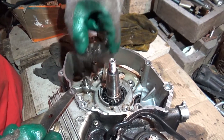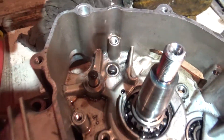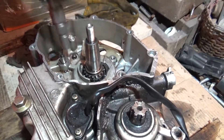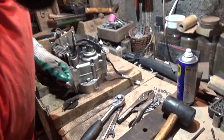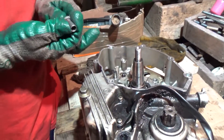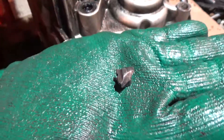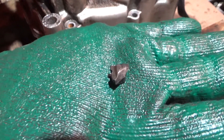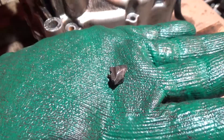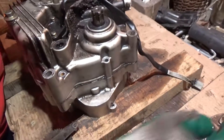I'm going to pull this gear out — this goes like this — and I got one last. I'm not sure if it's a 10mm or an 8mm that I gotta pull. And the gear parts already started popping off of the engine, and I think this is why it was rattling. This came out from the engine and so I think this is a part of a broken gear — that's why it was having issues with second gear.